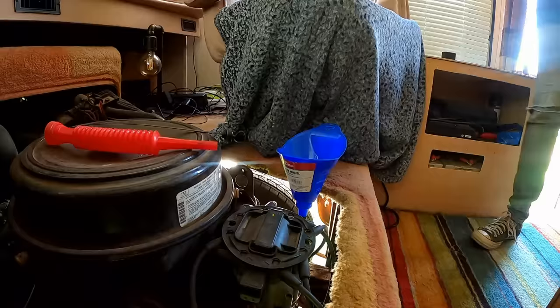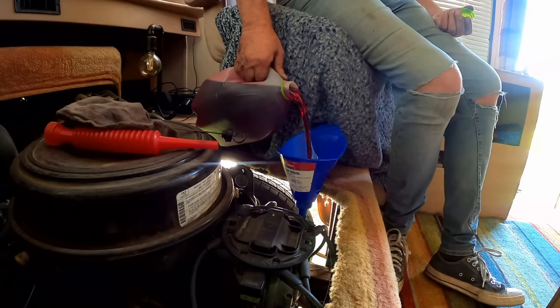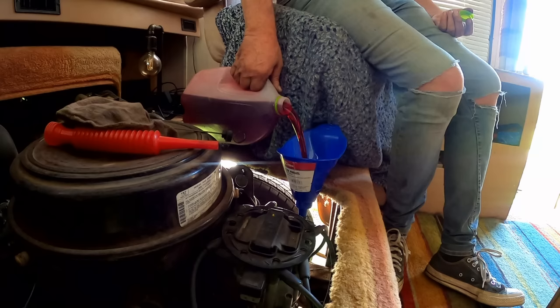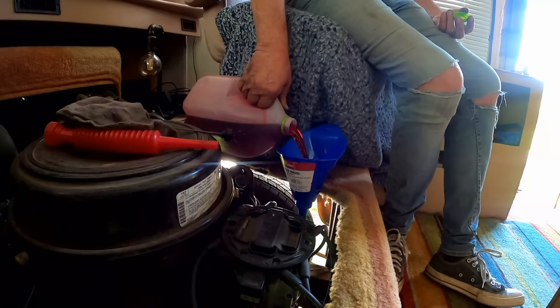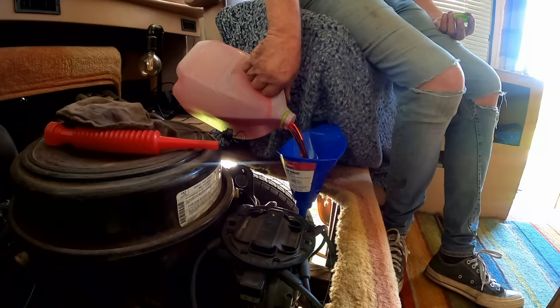All right. Well, I was fortunate enough that the transmission shop sold me bulk transmission fluid at wholesale price. And so believe me, I got a really good deal on this. And he said to put about half of it in. He said it should take about 13 quarts. He said, so, whatever, 6 or 7 quarts. He said, and then, of course, the transmission in park.